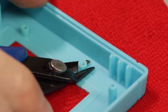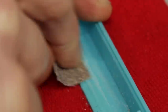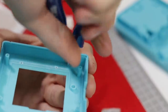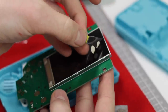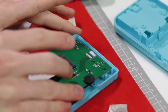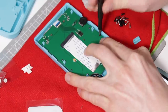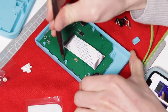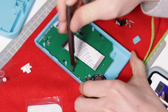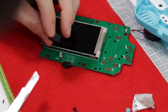We have to cut these two posts off to make room for the new elongated screen. I also had to remove a further piece in the top right hand side. After this is done we can remove the screen protector and drop the whole thing into place, which is one of the only steps you need to do if you buy the pre-built kit. There is a bag of screws included with the kit — go ahead and screw the PCB back into place. Once I had done that, I found the rubber pad caused too much pressure underneath the shell, so I took the whole thing apart again and removed about two millimetres off of that.